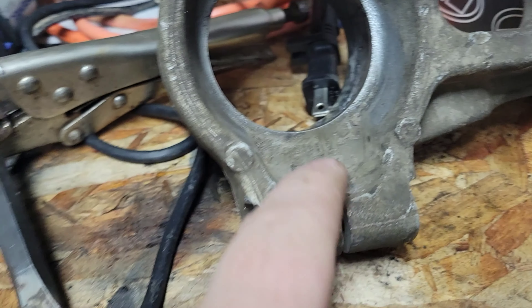What I want to do here is show you guys what I do to push the new bushings in. I did put a whole lot of anti-seize in this stuff here. Somebody else had said to me, are you using anti-seize? And I said actually I'm not — I'm going to use anti-seize. So basically what I do is I'll get the bushings, kind of put them in place here. And I actually put them in the vise with an impact socket. This new vise — I bought this from Canadian Tire. It's a six inch.